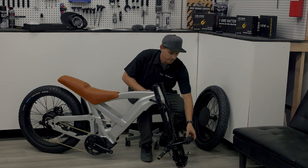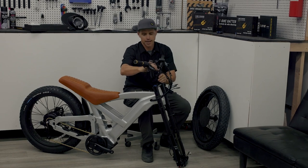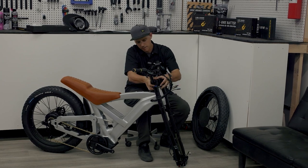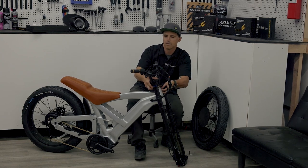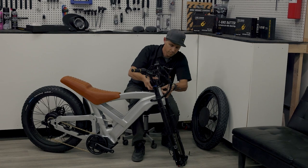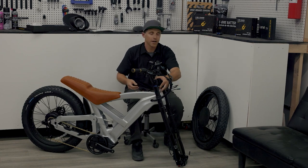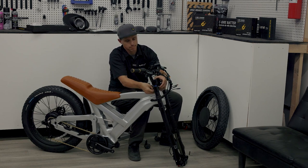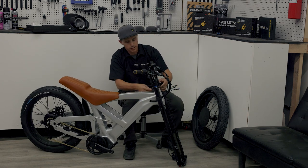To install our handlebars, I'm just going to gently lift them up — make sure it's not twisted or kinked as you flip the handlebars up to the top of the fork. We're going to line the stem up with the upper fork crown. Then I can grab one of our M10 bolts, line it up, and just get those threads started. Once you've got the threads started on one side, go ahead and grab that other bolt and do the same to the other side. With both threads started, go ahead and use your wrench to tighten those things down.